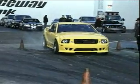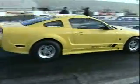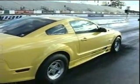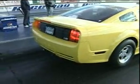We're going to head out to Englishtown and hopefully get some testing in this week. The car definitely looks like it has 10-second capabilities. With the 3.73 gear ratio, that might be the only thing holding us back — usually we go with a 4.10 or 4.30 ratio. I also put a stock torque converter back in my car so it's not going to launch quite as hard. However, with this much horsepower it should be capable of mid-10s at almost 130 miles an hour. I'm really excited to get behind the wheel — that'll be pretty much the fastest I've ever been in my car.